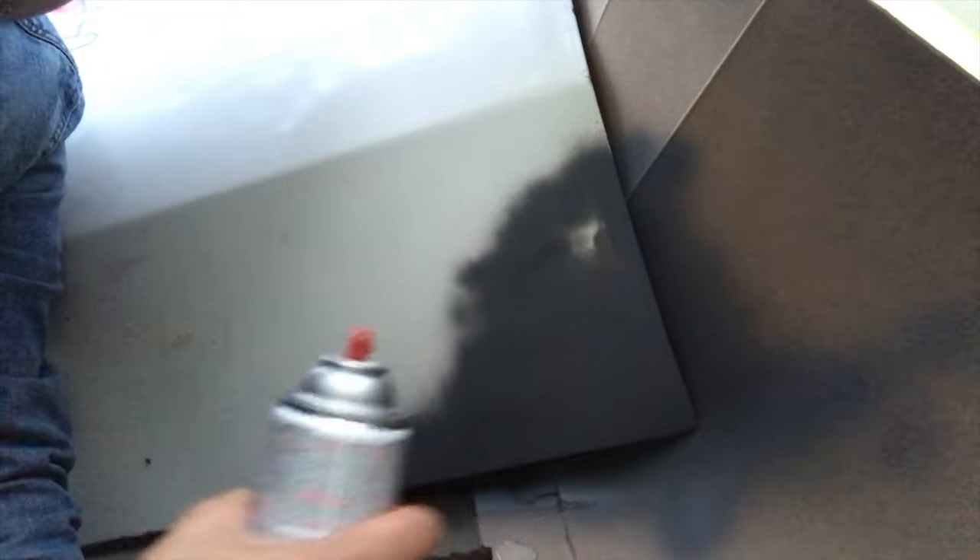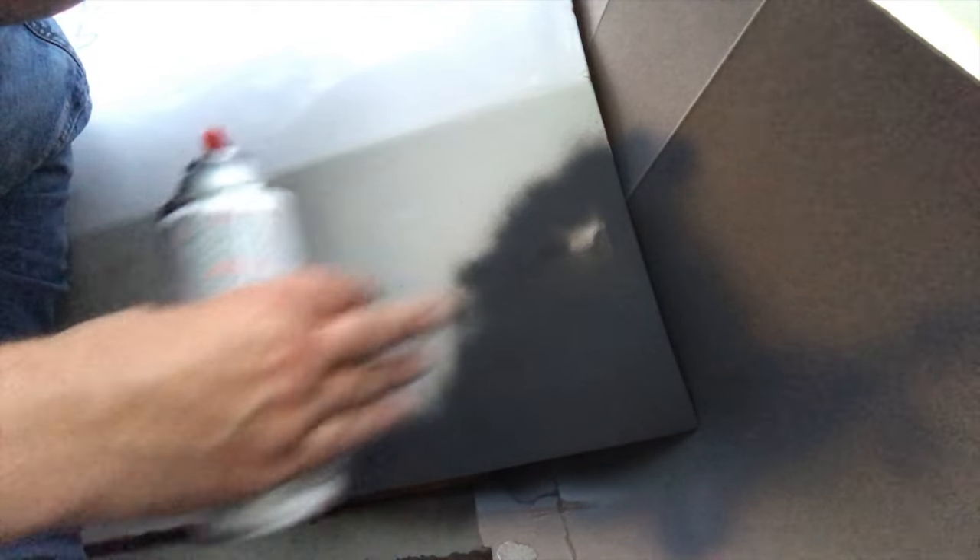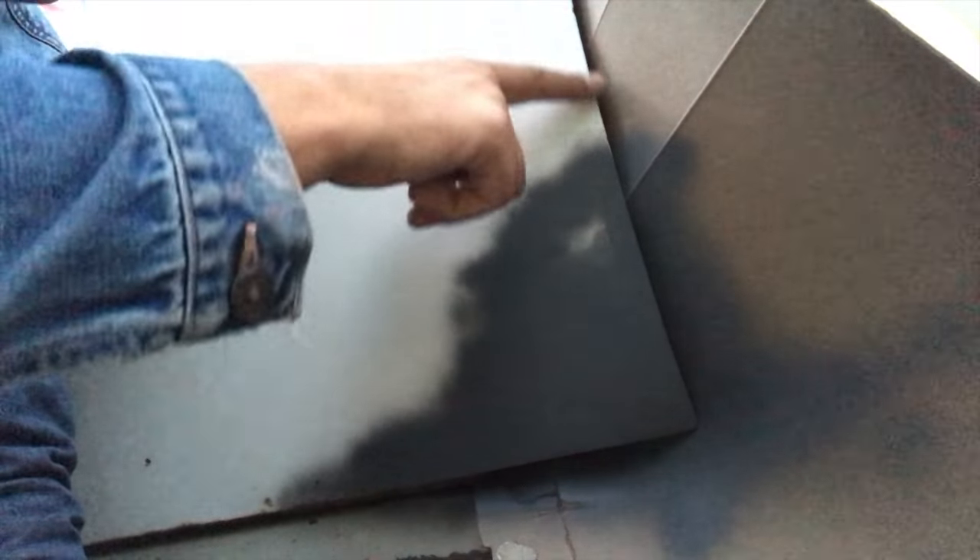I've got some primer put on the car and I've kind of feathered it in. I've got some cardboard up just so it doesn't spray onto the parts you're going to see on the door. After this dries I'm going to be able to start putting some of the white back on, and hopefully it'll match — luckily white is a really easy color to match. It doesn't reflect light the way a black or darker color would, so matching is a lot easier. Now if this was a darker colored car you'd probably have to go from this line all the way back and down, otherwise you'd see the haze. This car is single stage, which means it's just paint — no base coat, no clear coat — so it's a lot easier to do.